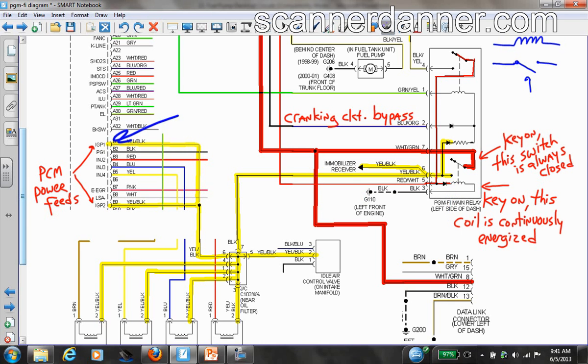You could think of these two power feeds as your on-switch for your engine computer — like you reaching down to turn your PlayStation on. Your engine computer needs one of those two wake-up signals. When you turn the key on, those two power feeds come in from the main relay to power the computer up. The computer also has other power feeds hot all the time for memory purposes, but these are your wake-up signals.